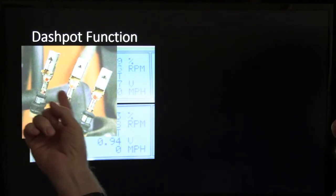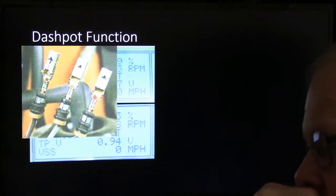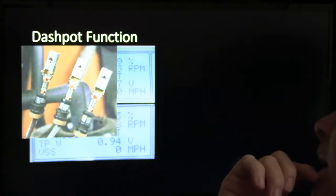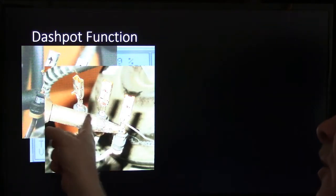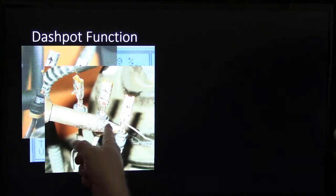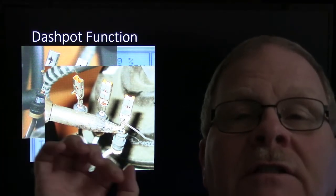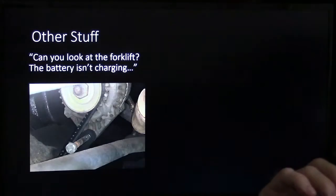And what we had was these right here. Those crimps look just fine. The wires look just fine. But what I wound up doing on several of these, and I had to do that on some mass airflow sensors too that were throwing mysterious codes, but not on this one, anyway, we would make sure those things are standing up so that when you solder them, solder doesn't run down in here. Have them sticking up, get your solder in there, and just solder all these connections. And that's what it took to take care of that one. That's all it needed, was those connections to be soldered. It's really easy to do. Anybody that knows how to solder ought to be able to do that.